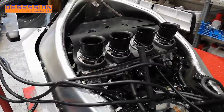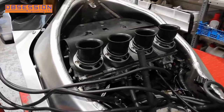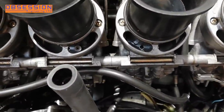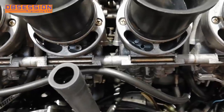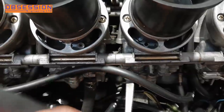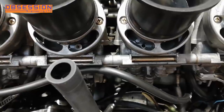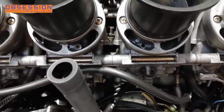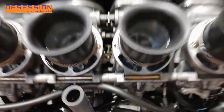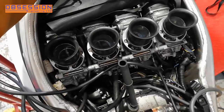To make that happen, I'm going to lift this little rubber flap and underneath there are little screws so we can adjust the throttle plates in the carbs — that restricts or opens up the throttle plate a little bit and alters how much air can get in, thus how much negative pressure is in the inlet tract. You do it with the engine warm, somewhere near idle, maybe just a little bit over to get a clear reading. The easiest screw to get to is down here and we go in from underneath with the screwdriver to reach it.